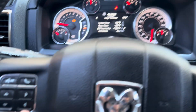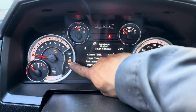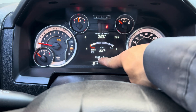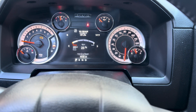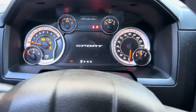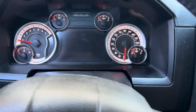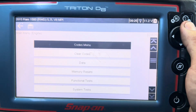With the key on, I'm gonna reset the oil light. Go through the menu using these buttons, scroll over to oil life, and then press and hold the right button to reset. Or you can turn off the car, key on, and step on the gas three times to reset it. I stepped on the gas one, two, three - and you can see it turns back to 100%.